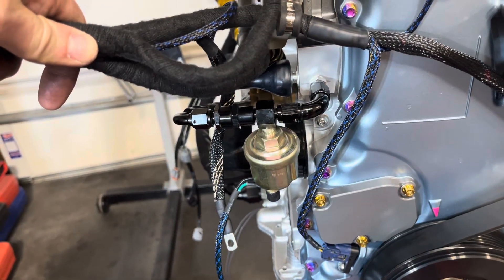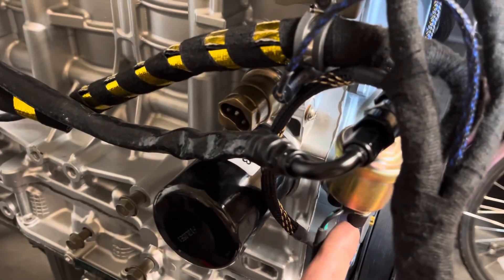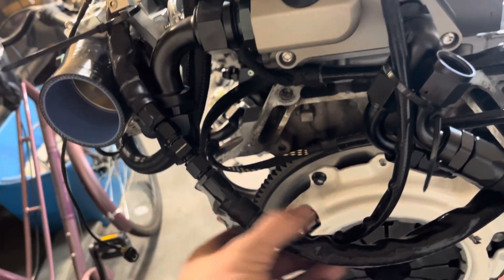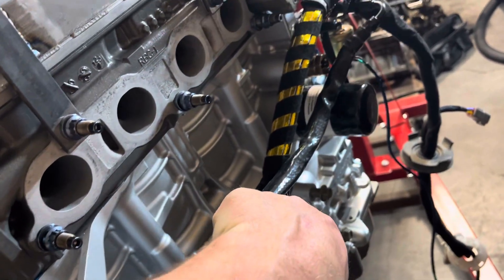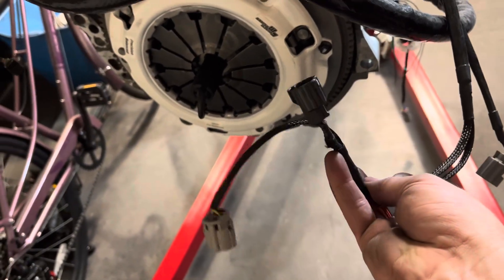I'll probably do a future video on what I do for oil pressure and oil feed for the turbo. We tap the block for a pressure sensor, and then we've got an AN4 going over here — tied out of the way, but it actually splits. I'm running another AN3 into the side of the head for balancing oil pressure on the head. The harness is sneakily wrapped around the back of the block, underneath where all the hot turbo stuff goes. There's also a separate sub-harness for the vehicle speed sensor, and we're running boost control off one of these guys too.